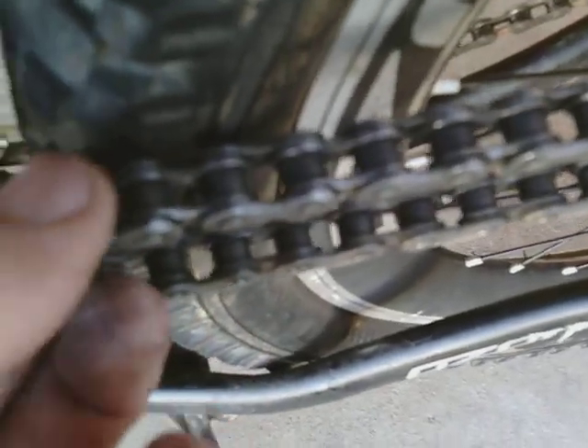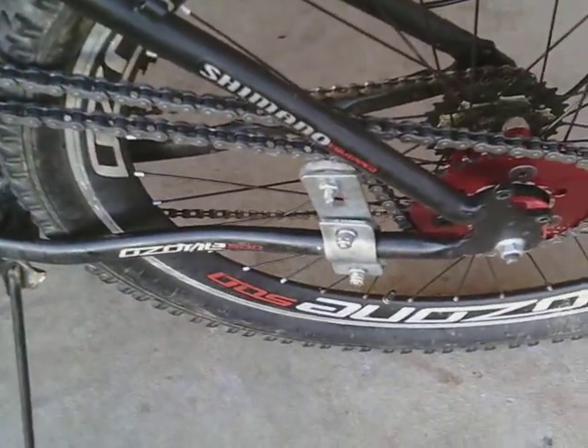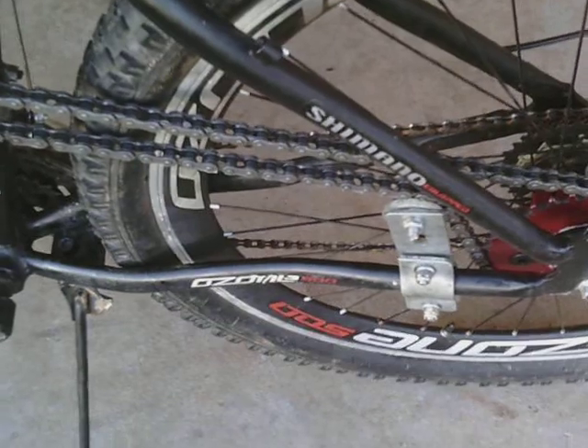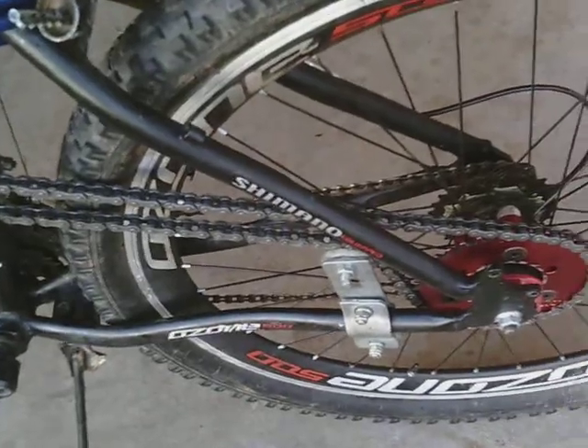Now, another thing is chain bite. I just noticed this on mine — you can see here where the chain is pretty much touching the tire. That's bad. So you have to readjust your tire. Mine may not look like it needs it, but obviously something happened because the chain is touching the tire. So I'm going to have to adjust that — but there you go. That's how you adjust your chain tensioner for your 80cc bike engine kits. I think the next video I'm going to be doing a ride video, and we'll see how that works out because I don't have a camera mount on my bike, so I'll have to find one. I hope you guys enjoyed this video, and this is Tyler from High Octane, signing off. Bye.